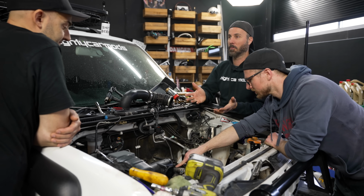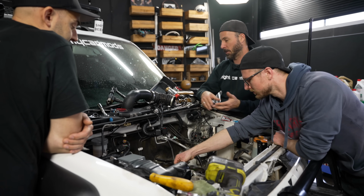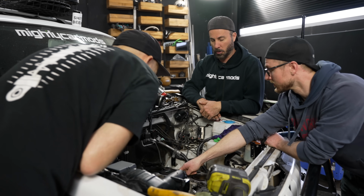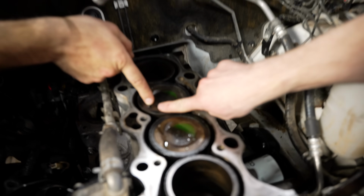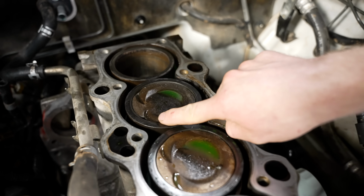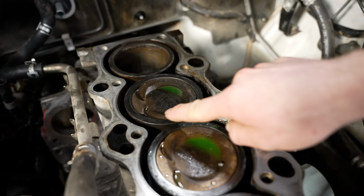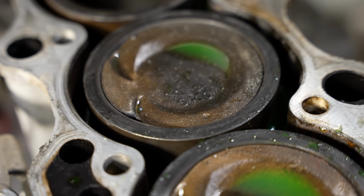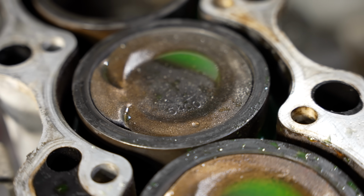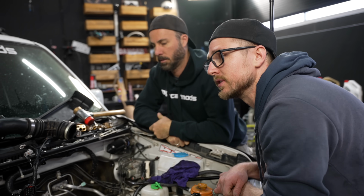I mean, we're hanging out because we want to do it, but what if you'd just taken this to a shop? Did you look at the melted piston? Did you just notice that? I did. Sorry, that edge of the piston's melted. We were so tired last night, we missed all of this. That is completely obvious to me and just clarifies how hot this motor got. Wow. I just don't know how you could beat on a Suzuki Swift that hard to do this much damage unless you'd pump 30 pounds of boost through the thing and no fuel.